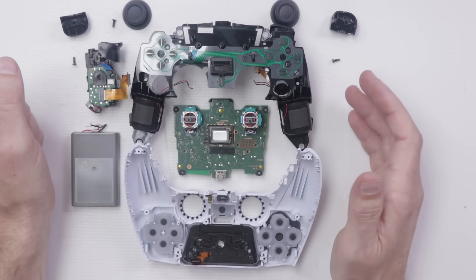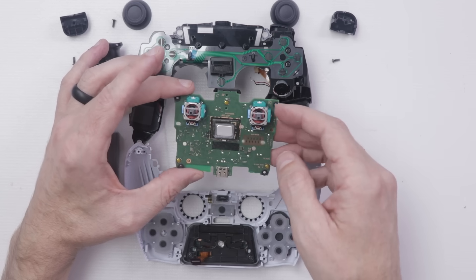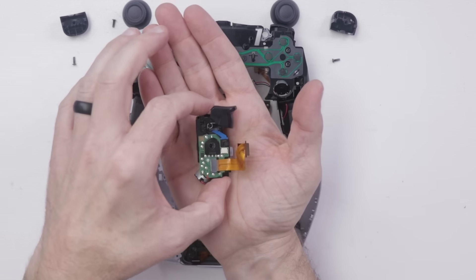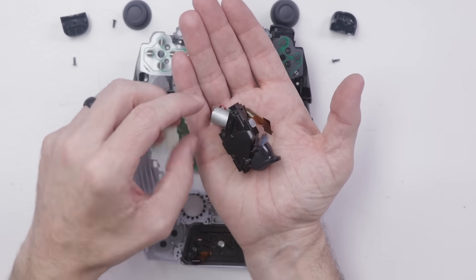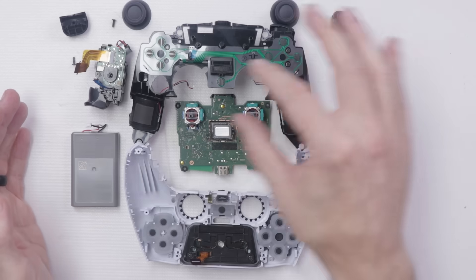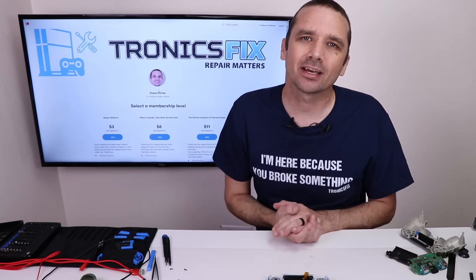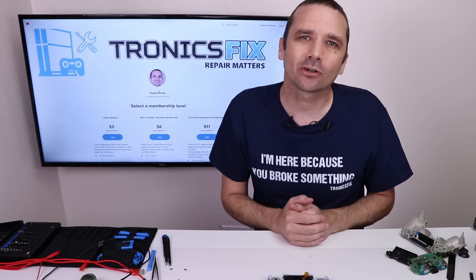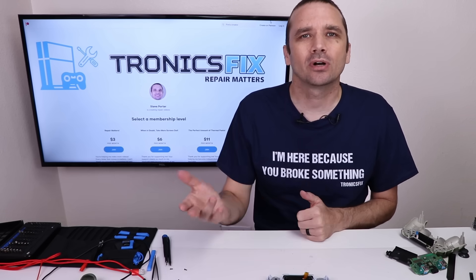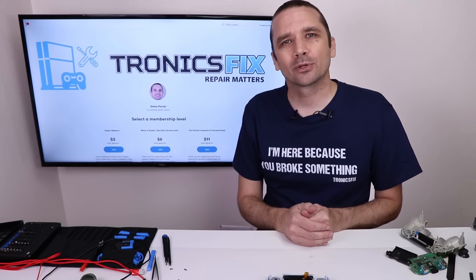Overall, I'm pretty impressed with the technology in this DualSense controller. One of the things I'm disappointed in is the fact that they used what looks like the exact same analog sticks — those are prone to failure and stick drift and are not easily replaceable. It's going to be very interesting to see how these new trigger systems hold up, as they could be quite the trouble spot if there are any weak parts inside. But the nice thing about it is these controllers are very modular and you can replace just the piece you need in most cases. I have started a Patreon — if you want to support me and my mission to fix as many things as possible, go to patreon.com/tronicsfix. Let me know in the comment section what you want to know about the DualSense controller. Thank you so much for watching and I hope you have a good one.